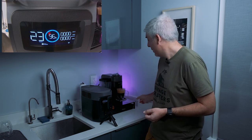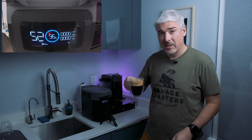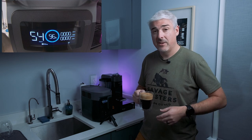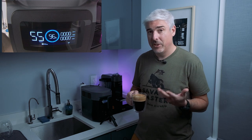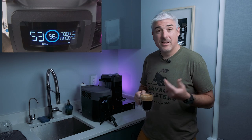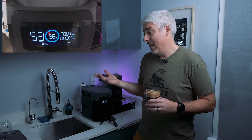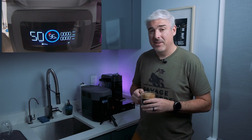So a cup of coffee is finishing up. You can see what we've got here — it may or may not look like a pint of Guinness, which is always amusing on a conference call. But EcoFlow passed the Will It Americano test with flying colors. You did hear those fans spin up at the beginning when the coffee maker was pulling 1600-ish watts, which isn't a surprise — that's getting close to the limit of its inverter — but it didn't choke, didn't die, didn't flip the breaker or anything. And what really impressed me was when it was going through the end of that brew cycle, pulling 60-ish watts to spin the motor and jumping up to 1200 watts to run the heating element, and it really didn't spin up the fans in any particular level.